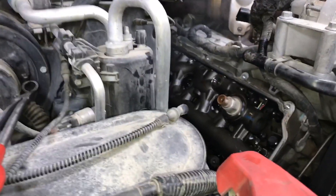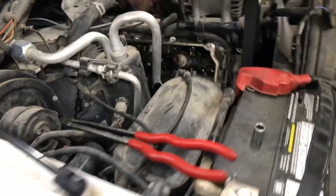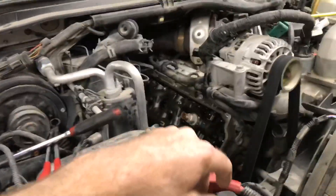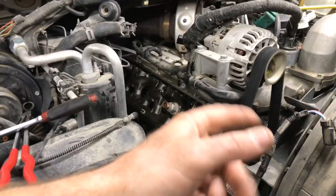The STC fitting is going to be in the future of this truck at one point or another, so we'll just find out right now whether it's now or later. Let's go ahead and pull it out and change it — pull that stand pipe out. We do have stand pipes here, we keep them here. The O-rings go all the way to the bottom. Now this would be another one of those instances where I'd really rather not disrupt the top injector O-rings.